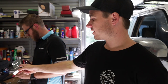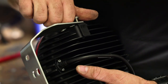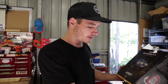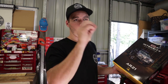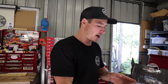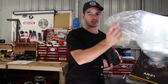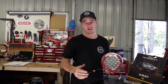It's a nice stainless steel bracket that gives you adjustment for up and down on the spotty. We're screwing that onto the spotlight now. Depending whether you're running light bars or anything else, keep in mind I'm running one flood and one spot — one gives you that nice long distance straight beam down the road, and the flood doesn't go quite as far but gives you a nice wide spread. If all you're running is just the two spotties up front, it is always a great idea to run one flood and one spot.